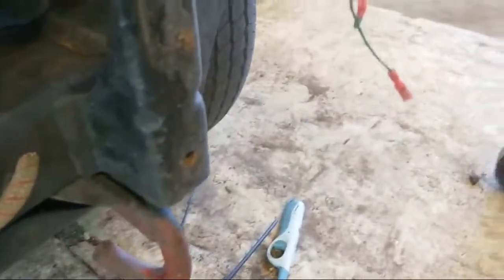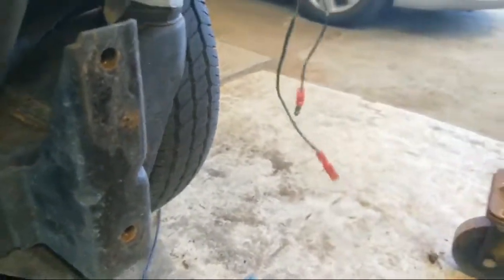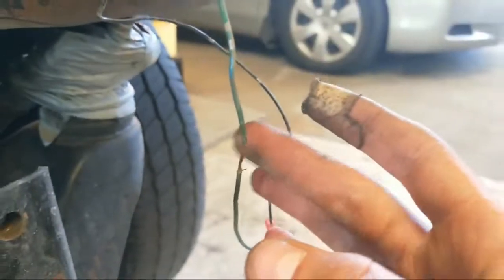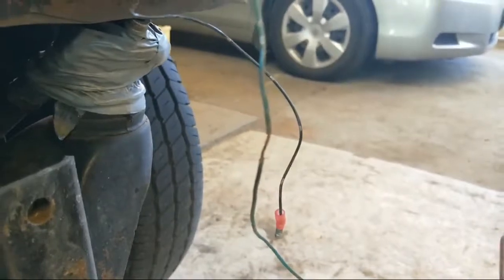I am now using this shrink wrap stuff because it's professional and it works. I had one really difficult wire in the dash that I had to fix up because it was kind of dodgy. It had one of these going to 4 wires, and it was a power wire taking about 3.5 amps, and it was pretty small. It's the same size as this, and this was the delivery wire for 4 other wires, and I was like, nah, it's a bit dodgy.